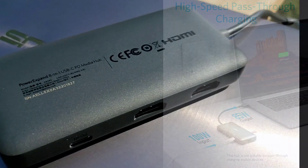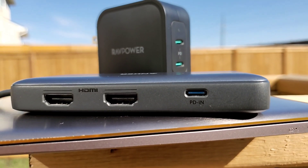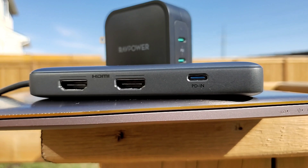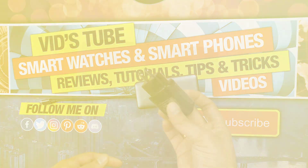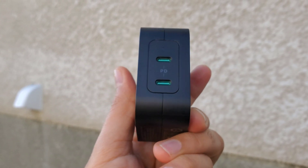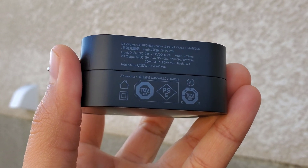This adapter has 100-watt input and 85-watt power output capacity. However, it needs about 25 watts for its own operation, so if you don't have a charger with more than 60 watts you won't be able to charge your laptop while using it. For example, my Samsung 30-watt fast charge adapter was not sufficient to charge the laptop through this adapter.